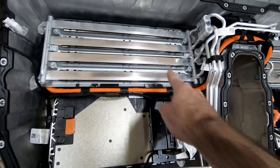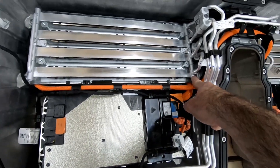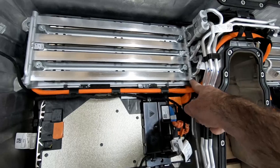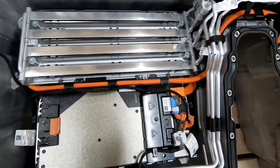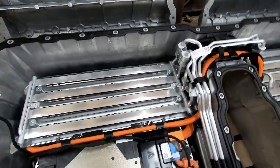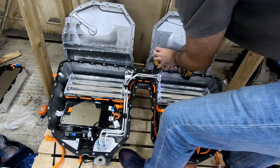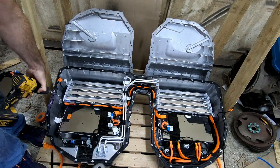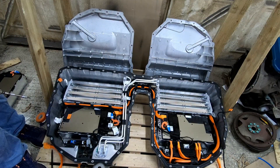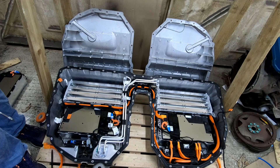With that unit out, you can see the cooling setup here. Basically it's a strip of aluminium between an air conditioning cooled pipe. These have an E8 Torx just holding it together, so we can get those undone and try to pull some of these bits out, giving us access to number one and number six. The plates themselves are actually held on with T27 Torx bits, as are things like the BMS main module. Just a few more screws to undo and then we can look at the lower tier.